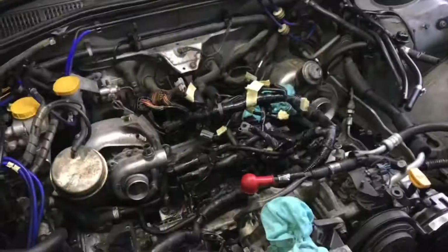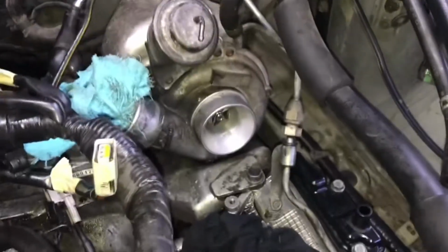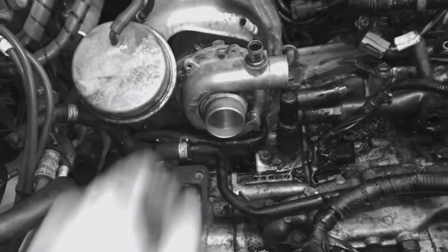I'll deal with the rest of that later. That's another day. Now, don't forget to cover your inlet ports, because you don't want to rebuild the turbos with debris in the engine, and don't forget to cover your turbos too. Also, I forgot to mention that the hood scoop lets all the water in if the car is outside. Don't leave the harness where I left it, because I got some of the connectors wet.